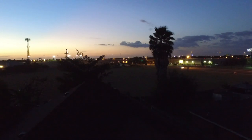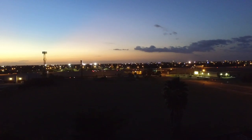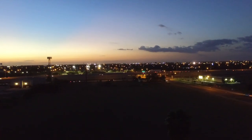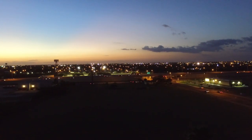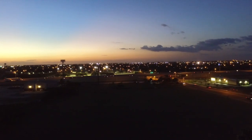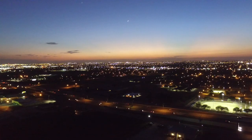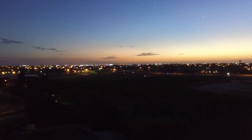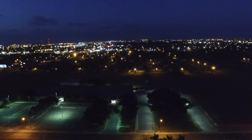So if you're a first-time drone owner like me just trying to get it going, it's not as plug-and-play as you think. You have to sit and wait for it to update — that's probably mandatory every time you buy one because there are always updates. But lo and behold I got the drone in the air. It took about two hours of updating firmware and software and a whole bunch of spinning, with the whole neighborhood laughing at me. It was all that RC button on the bottom of the drone. If you don't hit that one, you're gonna be there for two or three hours running through batteries. On the Phantom 3 standard, hit that button on the bottom, it finds the controller, and that's it.